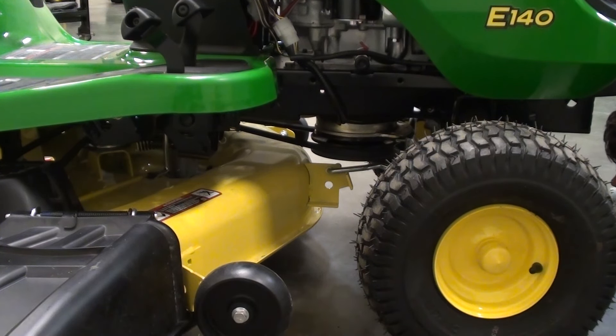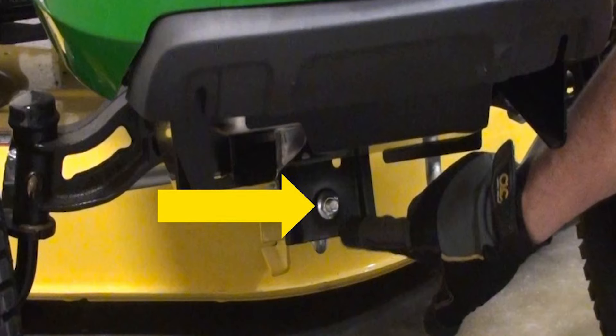The next step is measuring the mower deck level front to rear. Turn the right blade so it points straight forward, then measure from the blade tip to the level surface. Take measurements for both blades and ensure the front blade tip is at least one-eighth to one-fourth of an inch lower than the first measurement of the rear blade tip.